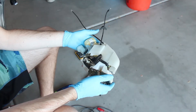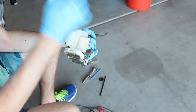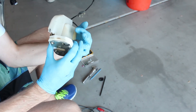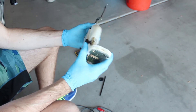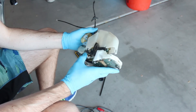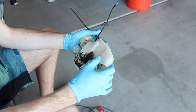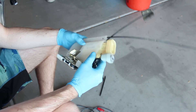This is the door lock actuator after you remove it from the door. On the back you can see the little flap that the actual door handle pushes down on whenever you open the door — that's how the door actually opens. Whenever you're reaching up behind this, you grab it with one of your fingers, pull it down, and wiggle it out. Once you've done that, you're ready to start taking this little assembly apart and replacing the actuator, which is this piece right here.